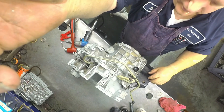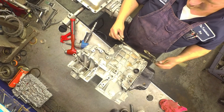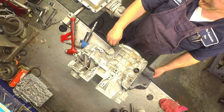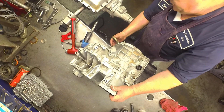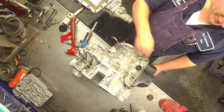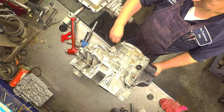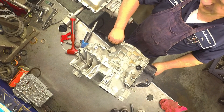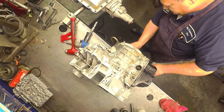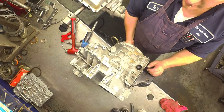I also forgot — some of the earlier ones used to have a vent right over the solenoid assembly there. They were bad about blowing the fluid out of the vent. So if you've got one that's an earlier model and it's blowing the fluid out, you're supposed to relocate the vent — just move it away from the solenoid assembly and put a new hose on it. You just need to get it off of the solenoid assembly because it would squirt fluid right off of there.